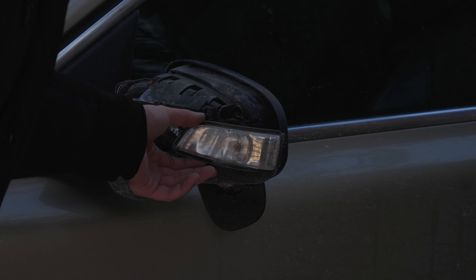So I got the little bulb out. Now what you want to do is make sure you peel all the plastic off, because once you install it, it's installed — you can't really take it off after. Pull it off a little bit on the side. You want to make sure you have the right side — this little clip right here goes on the left side. Make sure you connect this first, just push it in and plug it in. Before you install everything, you want to make sure that everything works, so I'm just going to seat this right here and go inside the car and try it out.